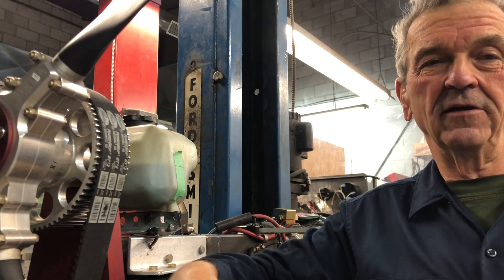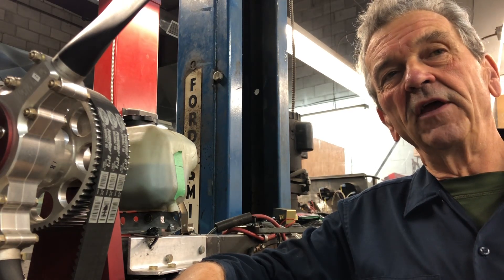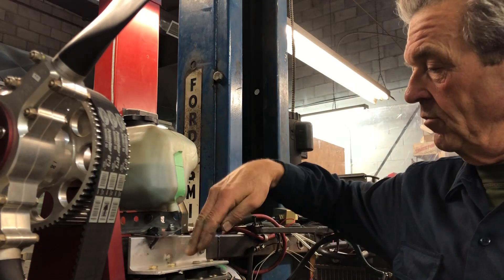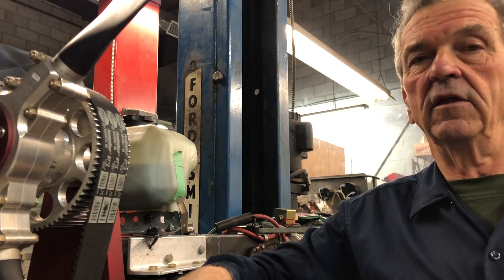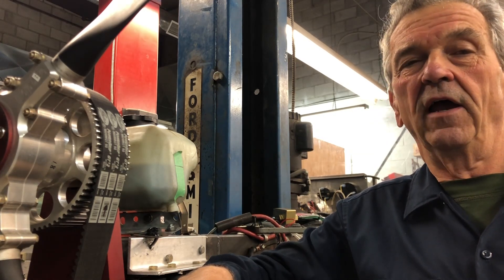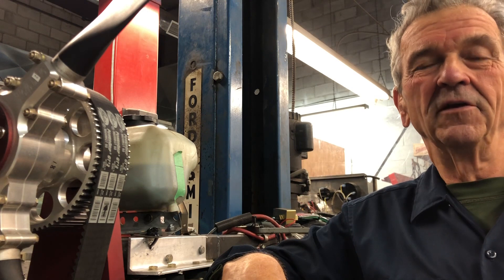Anything over spec is going to vibrate like no tomorrow, and we don't want it damaging the engine. On the Challengers with the mount plate — it has eight Lord mounts — the engine can be vibrating pretty badly and you don't even feel it in the airplane, so it's not that the pilot is inattentive. Vibration can affect the fuel mixture, froth up fuel in the carburetors, loosen bolts — it just goes on and on. Vibrations in airplanes: we just don't want them at all. Thanks very much for watching — have a great day!